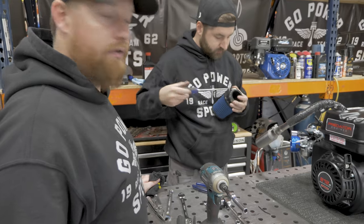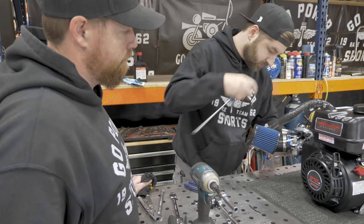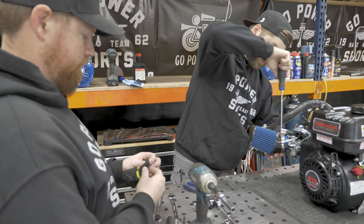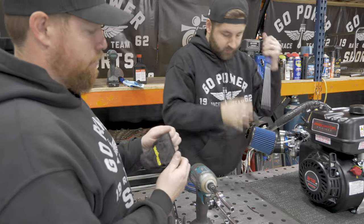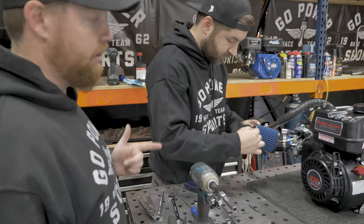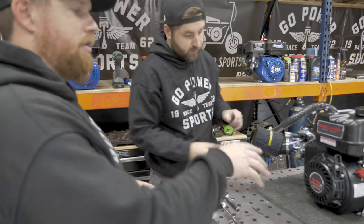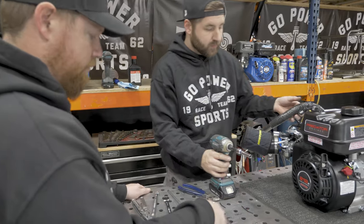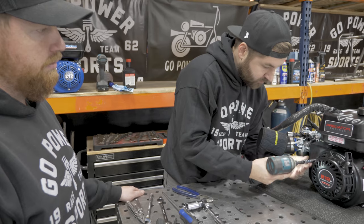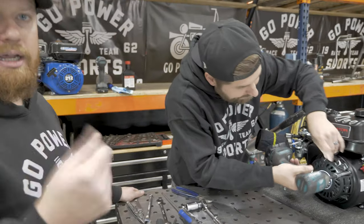He's now going to put on the air filter and tighten up the clamp with a Phillips head screwdriver. In the Stage 1 kit you have a choice of a few different colors — this is our black nylon filter cover. And the last thing he's going to do to this engine is go ahead and swap or rotate the starter. For most go-karts and minibikes, you want to rotate it so that the starter is back here so that you can access it.